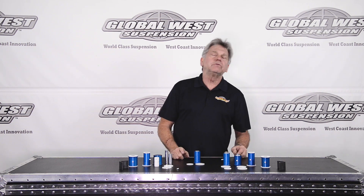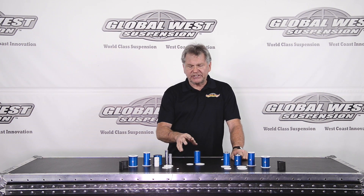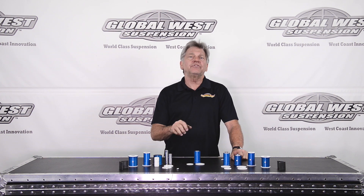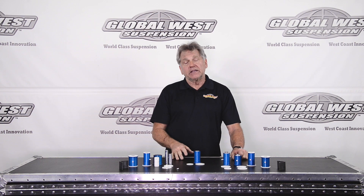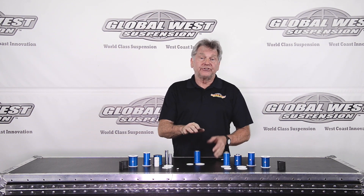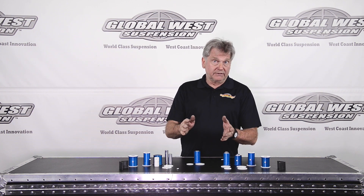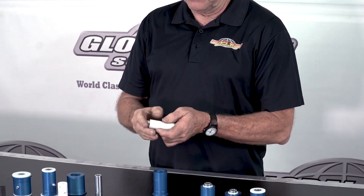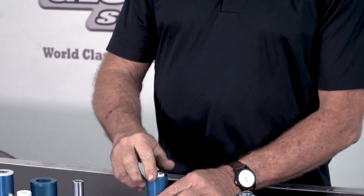The reason why we do that is because by having six surfaces, no matter what happens, the bushing is going to allow movement on that control arm. It's going to go straight up and straight down. It also does deflect fore and aft, or it'll allow the arm to shift a little like rubber would under severe loads. There's a steel pin that goes inside, slides in here like this, as you can see.